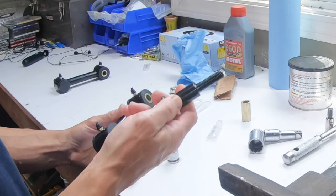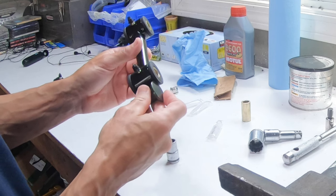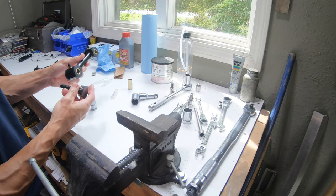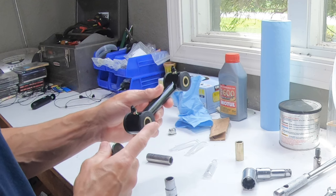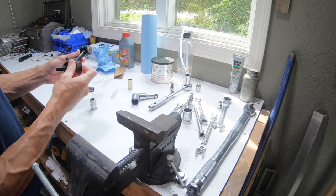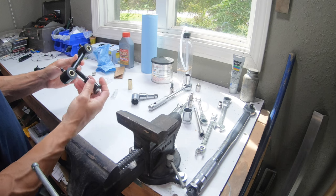So here's the new bolt that we're going to use for the lower mount of our dog bone, so we have more clearance with our leaf spring, because with the offset shackles it moves it a lot closer to the leaf spring, because the width of the sway bar is all fixed, right? So this gets really close rather than having a big shoulder head or a nut, depending how you orientate it. You need to have more clearance.